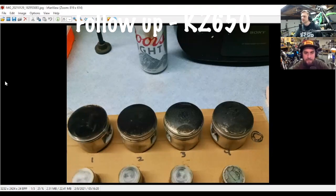All right. So here are the pistons. The two on the right are a little wet. One and two are dry. Any evidence of oil burning here? I can't tell. It looks totally normal to me. Who knows what this could have been, fuel or oil? Motors look like that after 4,000 miles in some cases.